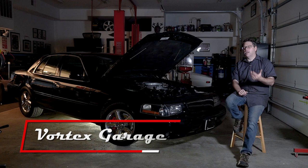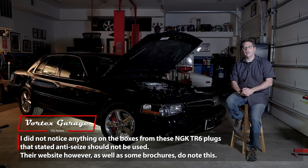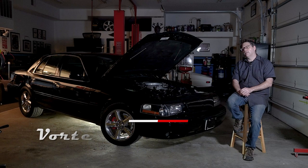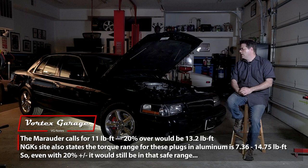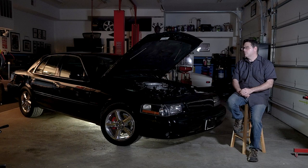One thing I'll nitpick: when I went to NGK's website, it wasn't readily apparent where to find that detail. And the boxes of spark plugs don't say anything — the ones with trivalent coatings don't have a warning about not using anti-seize. They assume you'll know it. The biggest thing I can see is it's such a low torque value that 20% isn't a huge amount, but it's still important.